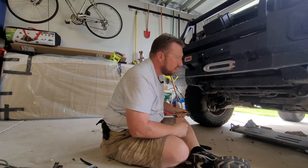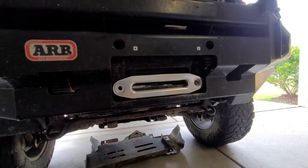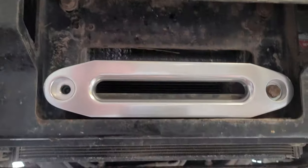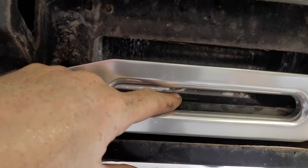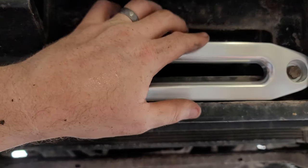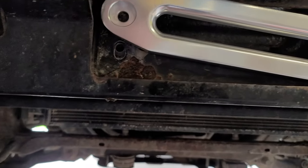There may be another problem. Looks like we're done for the day. You can see here - and I'll switch into close-up mode - that I am going to need what's known as an offset Hawse. You can see the way this mounts up down here. The factory bracket is still very much visible and will very much be in contact with the rope, and that's no good. That just won't work. You can see there's a whole lot of room up to the top here, and I need this to sit up there. So I'm going to have to get a different fair lead.